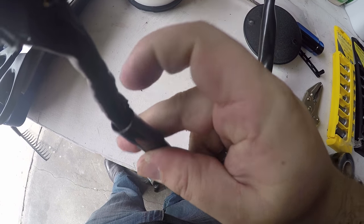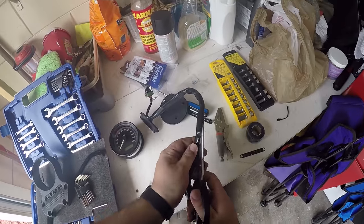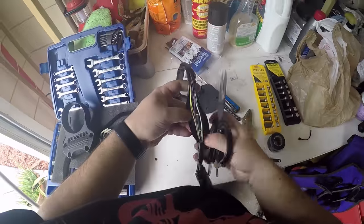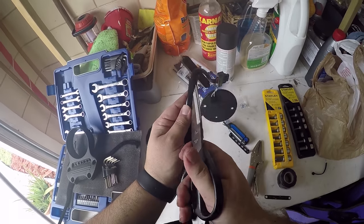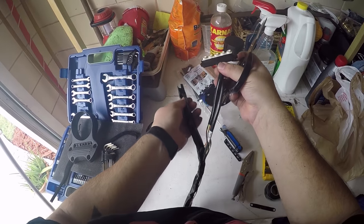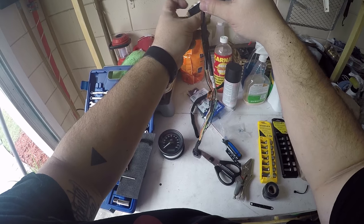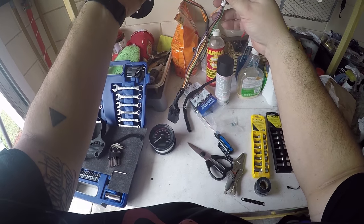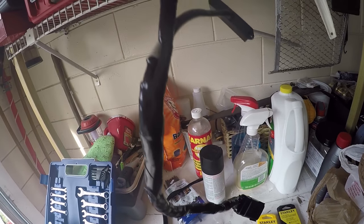You need to take off this little piece of protective plastic covering the wiring harness — be very careful not to cut any actual wires. If you notice, I'm doing very small snips. Remove that and you're going to be able to split your wires out to about that far. Don't pull anything too hard or force anything. Go ahead and use some silicone tape and wrap up the wires just like we did for the wire tuck.